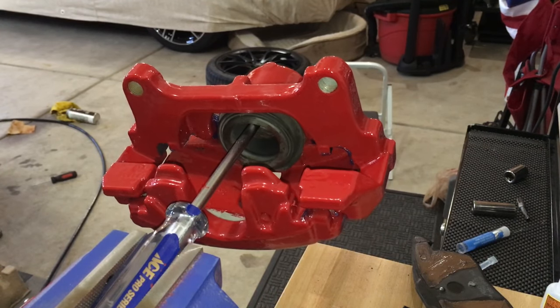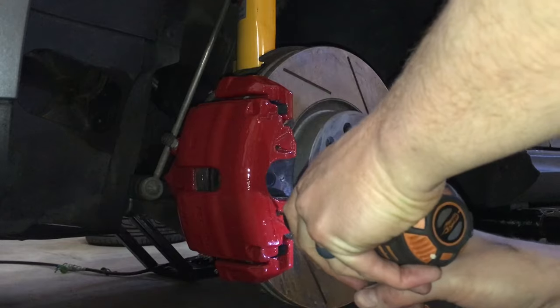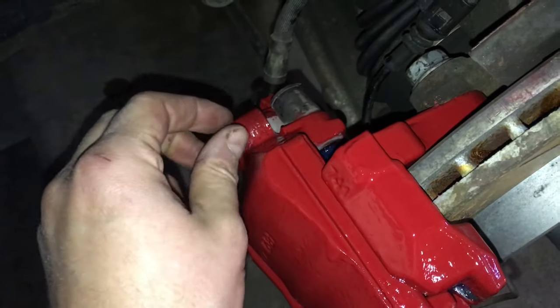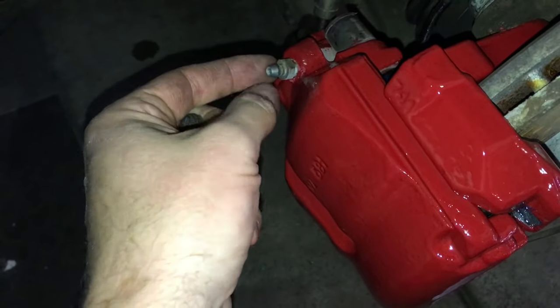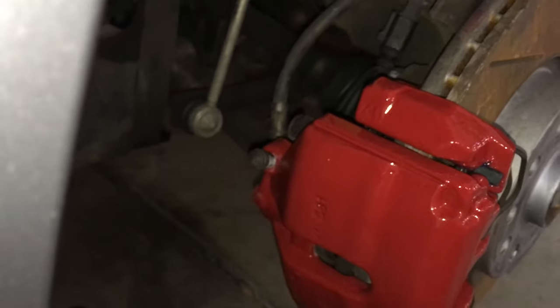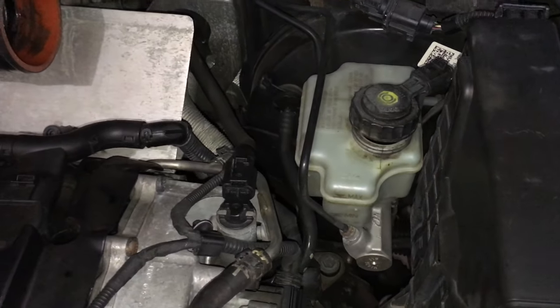We do need to put in the brake pads before we put this back on the car. Before we drive the car, we also need to bleed the brake lines. That's underneath this little rubber grommet here — we just take this off and there's a nipple there. We're going to loosen this up and let it drip out here as we flush the lines and bleed them so there's no air stuck in the brake lines. To bleed properly, you open that one up, then come up into your engine bay and open up your brake reservoir — that'll allow the air to flush out.